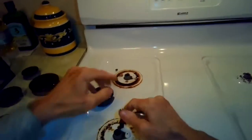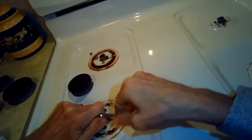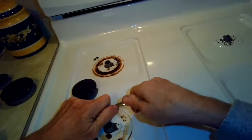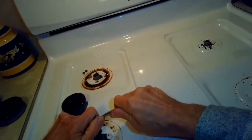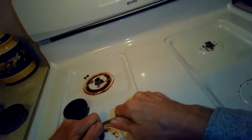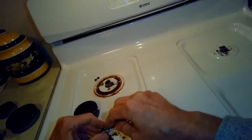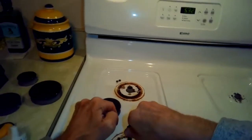I used a little bit of tension and then backed it off the other way, then a little more tension, then tightened it up again and loosened it — sometimes you can just finagle through the corrosion and get the screw out without it breaking. But if you use tons of pressure right off the bat, it'll break for sure. Using penetrating oil beforehand is best, especially if you can let it soak in for a day. Once they're all loose, use a regular driver to spin them out.